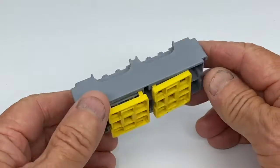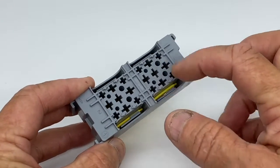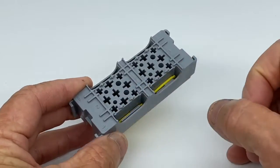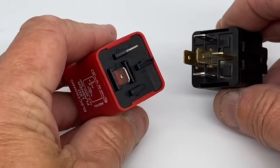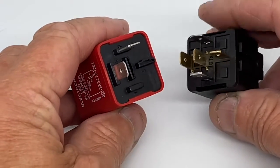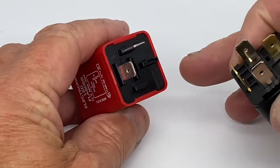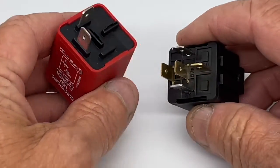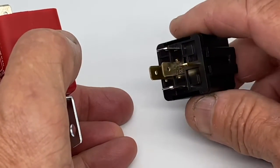This module has two standard relays — you can use any combination of terminals. All the terminals on this module are 6.5mm, so you only need to order two terminals if you're going to fit this two-terminal flasher relay, or five if you're going to fit this 30-amp changeover relay.